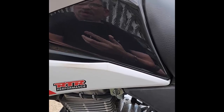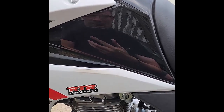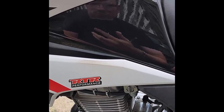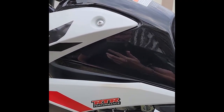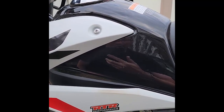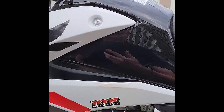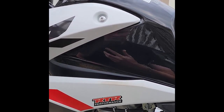The good parts about the jet were that I got a much better cold start and a little bit more top speed. But the downside is that it is using more fuel. I was able to get 280 kilometers without even using the reserve before I refilled, but this time I had to turn it over to reserve at about 240 kilometers. Part of that was messing around with the carburetor — I dumped the float bowl twice so that fuel wasn't included in the mileage — but I am getting a little bit less mileage with the new jets.